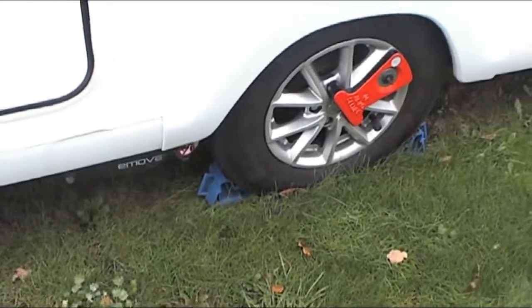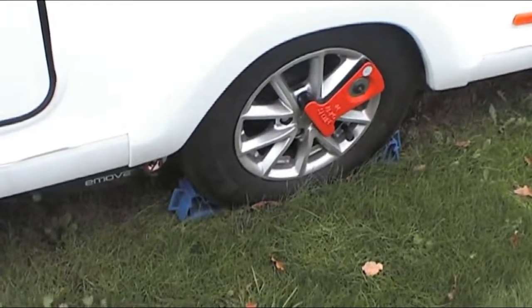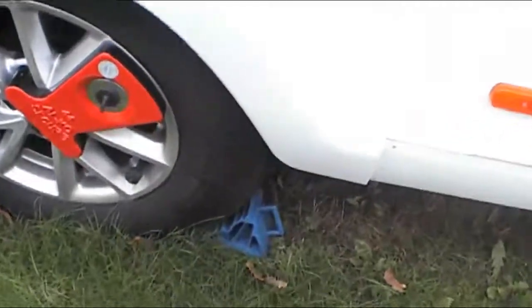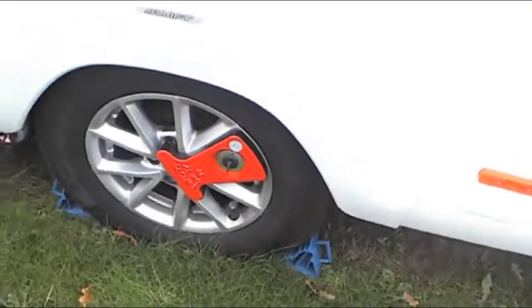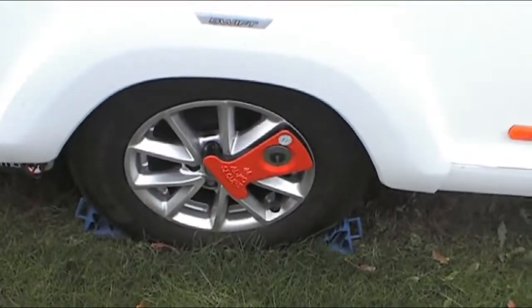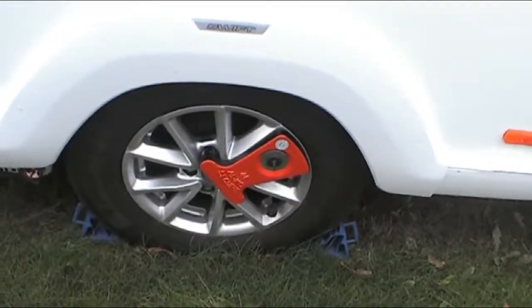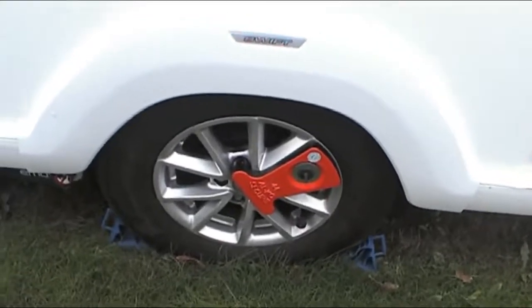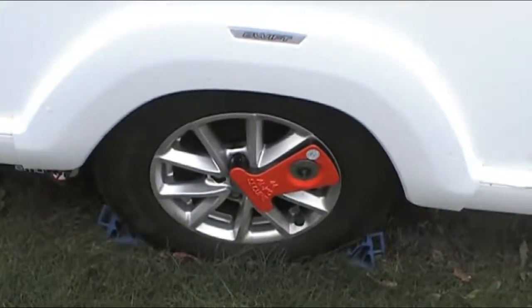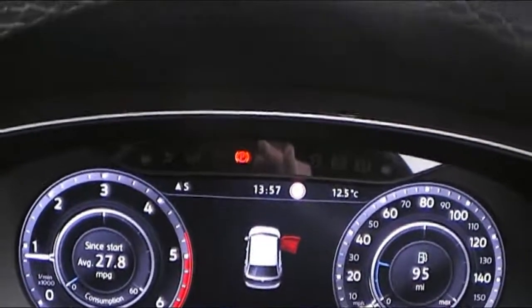For demonstration purposes, I have got the Alco hitch lock on the wheel. As we are jacking up the caravan, on the non-jack-up side, as you can see, I have placed two chocks there to keep the non-jacked-up wheel stable. The stabilisers will be lifted and the hitch will be applied to the front of the caravan to stabilise it, with the brake on the vehicle but not on the caravan.